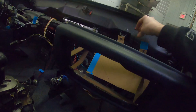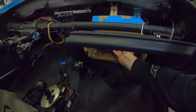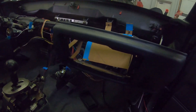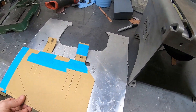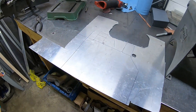This is what I got so far - just a CAD piece going in here. If I can get it to sit right here, it's going to kind of just hang right there and have a full dash, then kind of just sit on this plate. So I'll cut out some aluminum and see if I can make that work. All right, we've got our CAD here and I already marked up this piece a little bit to make our cuts and holes. I got the bends marked. Hopefully it's good enough to line up right. Let's get to work.